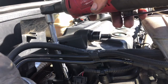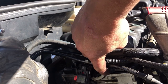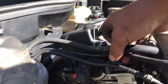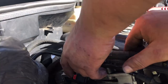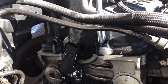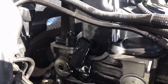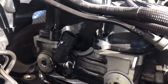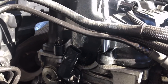Now go around and remove all 12 bolts holding your valve cover on. To get to the bolt on the front side that has vacuum hoses, pull the vacuum hoses off and the part pulls straight up so you can access the bolt. Use a deep 8 millimeter six-point socket — I ended up using a Craftsman one. This specific bolt was stripping with a 12-point wrench. Six-point is what you need — if you use a 12-point, it'll strip.